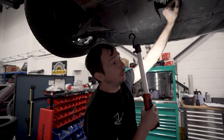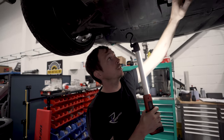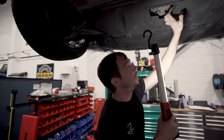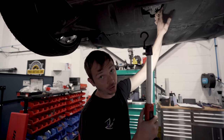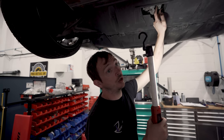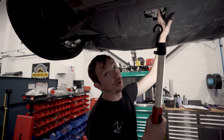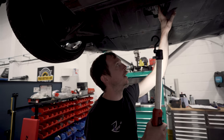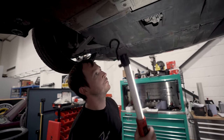We see that quite a bit in oil, don't we? You drain the oil out of these and it's black. Because what happens when a viscous coupling overheats, it vents to the gearbox oil. Then you drain the oil out and it's black, so we can tell when we drain them out. Like my Maha is electronically linked, which is fine because it's good enough to do it. Dyno Jets are mechanically linked, that'll work. You can't use a hub dyno unless you take the prop off. And obviously, if you want to do two-wheel drive, you have to take the prop off. But the R-tronic won't work on a hub dyno anyway, so we try to stay away from them.